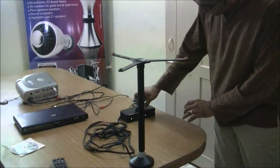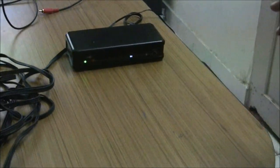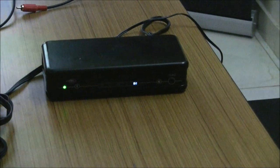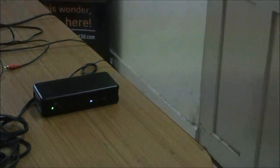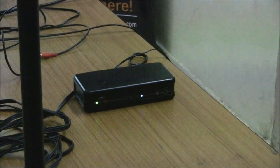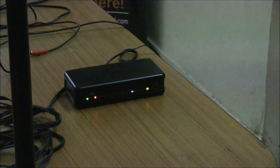The system made a series of fast sweeps and slow sounds, all captured and fed back to this box. You can see this light still blinking — it will blink for one more minute while it internally assesses your space in terms of acoustics and how many speakers you have placed. Our transmitter can connect up to 20 speakers, completely flexible from 1 to 20. But usually in a home, no more than 5 speakers are required. A person can start with a 2.1 system and enhance to a 5.1. With 5 speakers placed, that information is fed back and it takes one minute for the mathematical computation of what sound should come from each speaker.